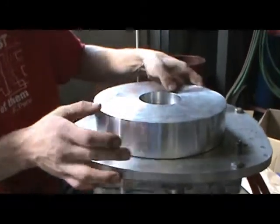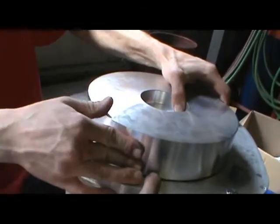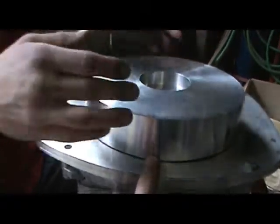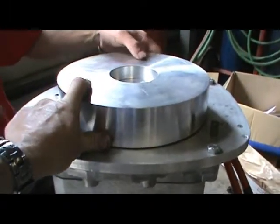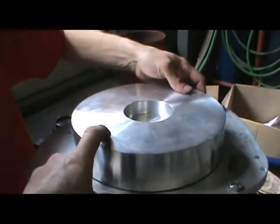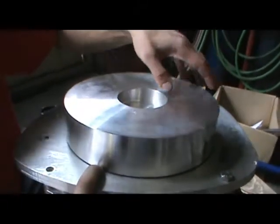You do, but you wouldn't want your fingers in there. Well, I didn't cut. Try that. I didn't cut this 80 thousandths. I cut it 80 thousandths shy from what you had programmed, because you're cutting this 153 thousandths deeper for that metal insert, and I picked you back up 80 here.